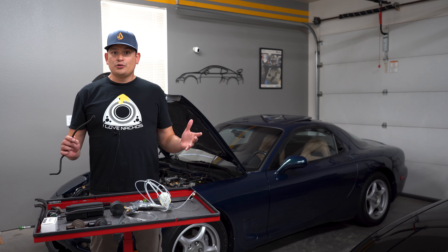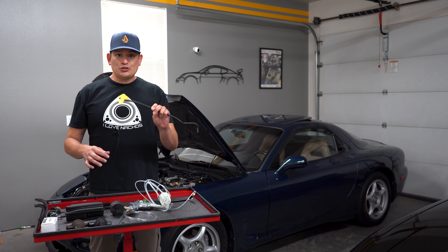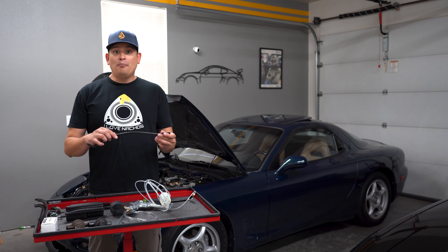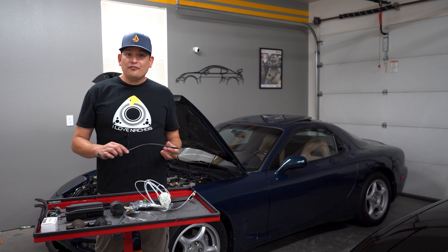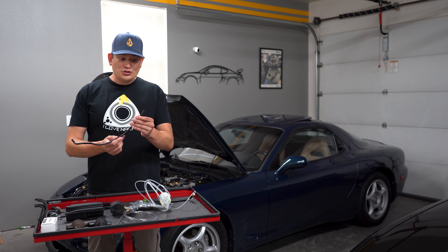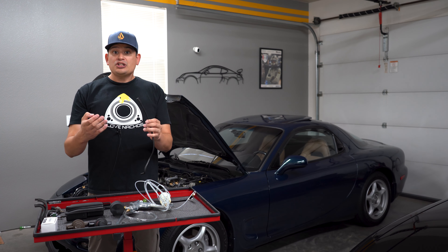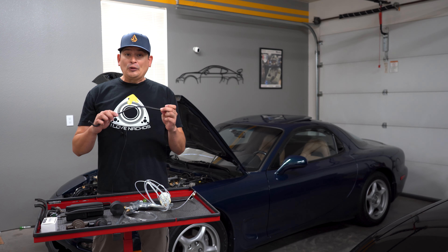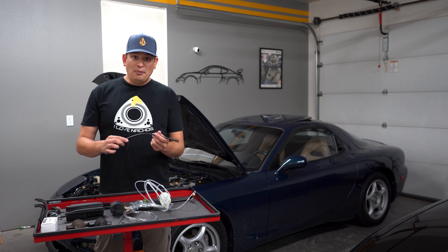The first thing you want to do is look around your engine bay and see if any vacuum hoses are loose, cracked, or really hard — you'll have to touch them to tell. With the RX-7 I can tell you they go bad. I just ordered a whole silicone hose kit to address that, because I have hoses so hard that at the ends they've molded themselves to a larger diameter, which can cause leaks.